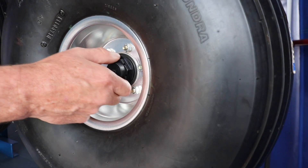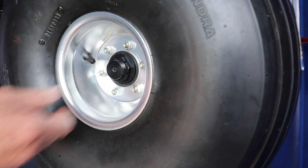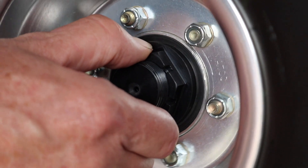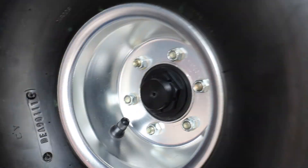It's a little bit of a judgment call — do I go to the next locking feature or the prior locking feature? The important thing is when you're on the ground, just double-check it and make sure when the wheel's rotating, the seal is staying stationary.